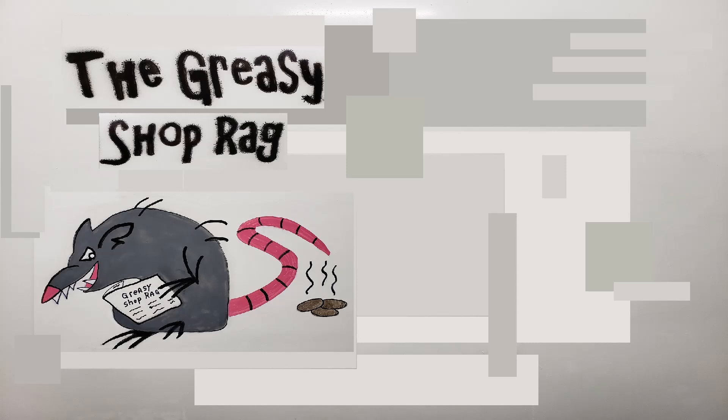Quick look on the other side of the carburetor to check the micro screen — it looks good — and I'm putting the cover back on. Now, I've said in other videos that any time I open up the carb I always put a kit in it. Well, I don't have kits for these — they're Chinese knockoffs that mimic some other Chinese carburetors that are more popular. If you know which kit matches, say a Zama kit, you can slap it in and you're good to go.